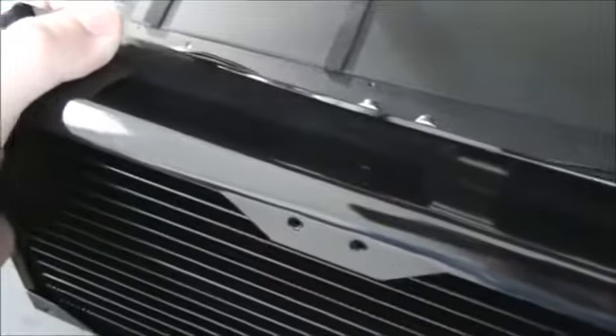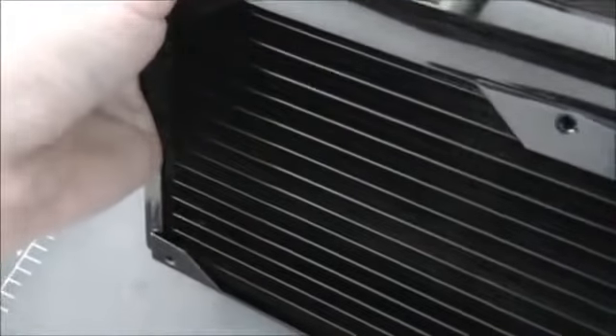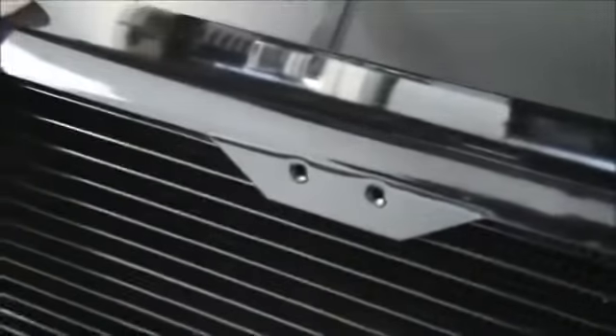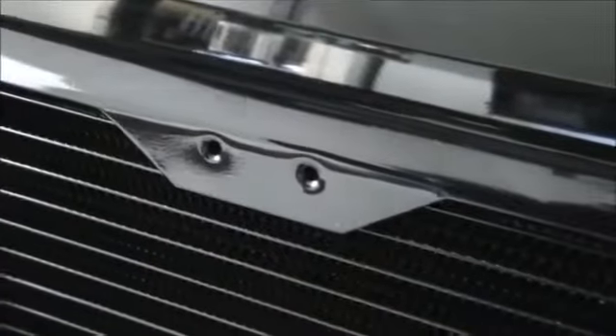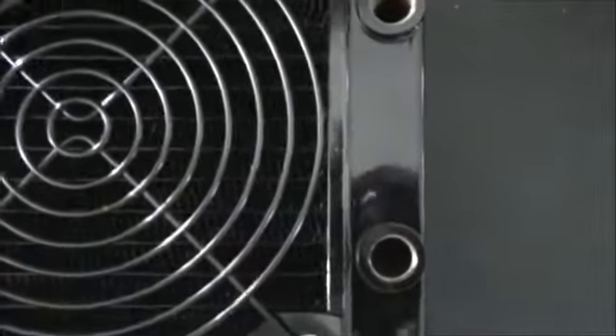That's Black Ice's most high-performing radiator. To get the maximum out of it, you really need some good high-performance fans that push a lot of air. It has a gloss black finish — I need to give it a bit of a polish before I install it, as it's got some marks and dust from the box. Extremely high quality radiator, right down to the paint job. It's got M4 threads for mounting and G1/4 inch threads for the input and output.